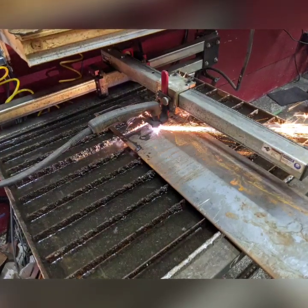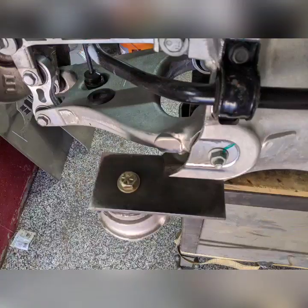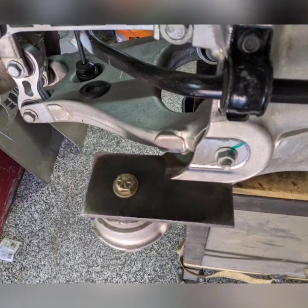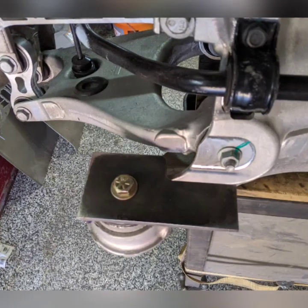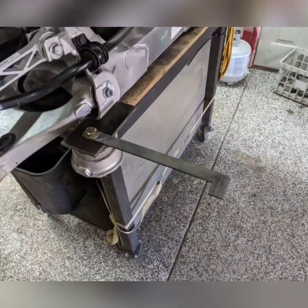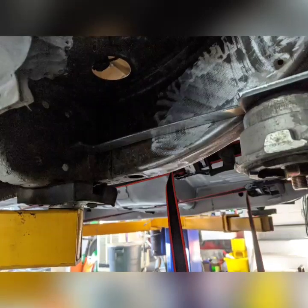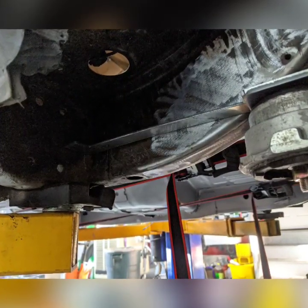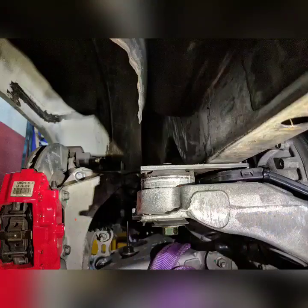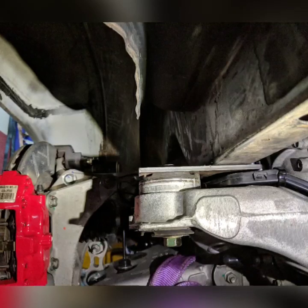This time the plates are cut from 3/16 material instead of thin sheet, so a little harder to do with simple tools. The first cut fit right around the area I had previously trimmed. I also cut some spacers, measuring that 11 and a quarter inches from the original leaf spring mount was the right spacing. With the plate resting against the leaf spring mount, I used ratchet straps with light tension, then shifted it until it was perfectly square on all sides.